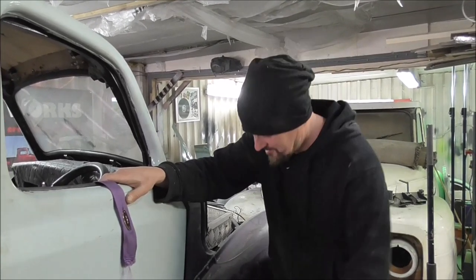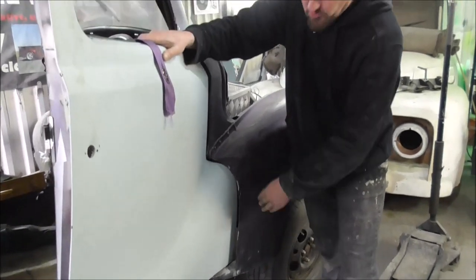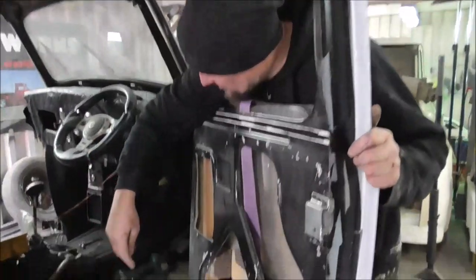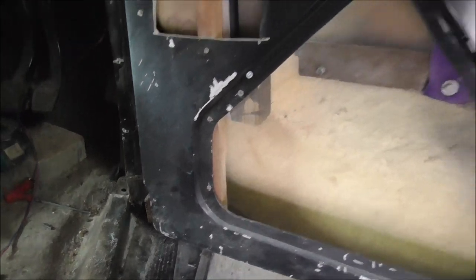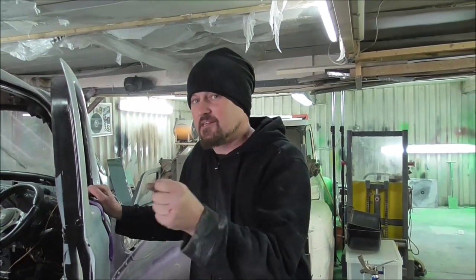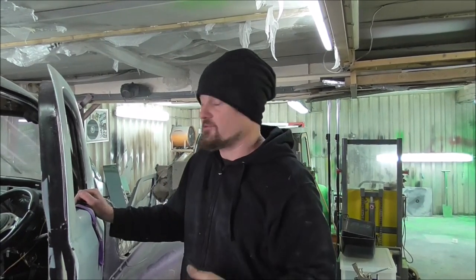So we're looking at the door. Full disclosure, I did make a bit of a mistake — I filled this hole in at the back of the wing, but of course the door has to actually swing into there, so I'll have to put another bulkhead in there to sort that out. That's no real problem. What is a problem is the bottom hinge of this door — it's just bolted into fiberglass. Nothing else holding that door on other than fiberglass. There's like a bit of a metal plate at the top, but down at the bottom there's a random piece of angle iron that seems quite sturdy, so I can weld the hinge to there, and when we do the interior we can cover all of that up.